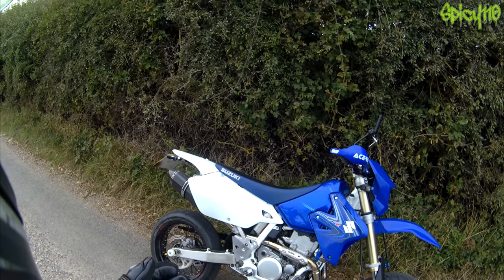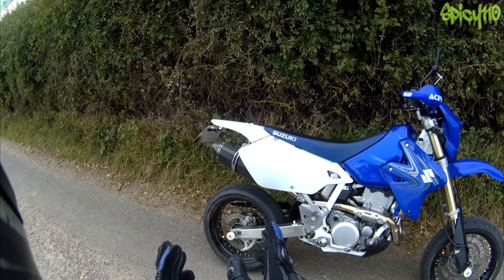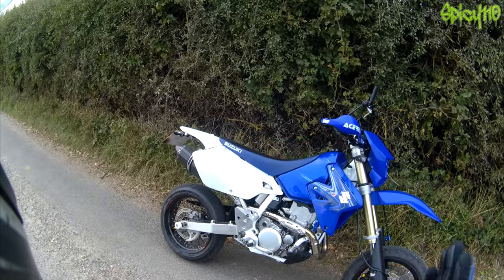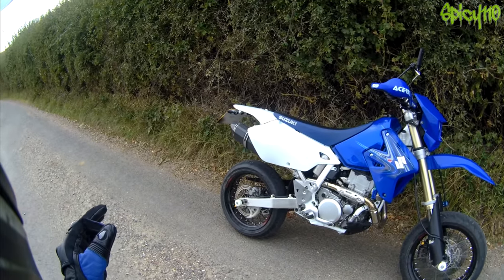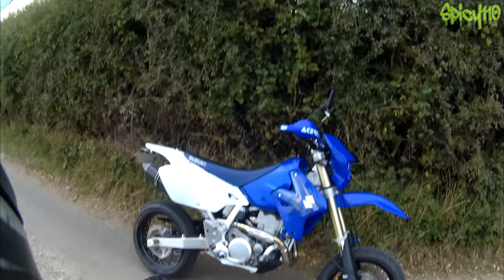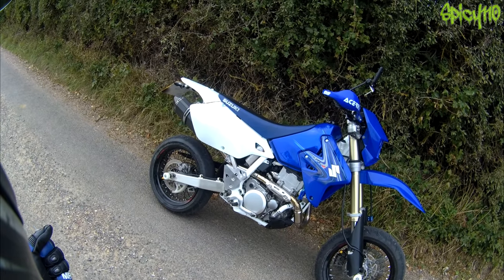What's going to be even more interesting is that I can now compare a 160, which was too big, to a 150, which is correct - because this has got a four-and-a-half inch rim. Before anyone says 'but if stock is 140 why go to a 150' - the profile is still correct, so it's not a problem. However, as I found that Zero to have such fantastic handling, it'll be interesting to see if this bike will be in any way similar to that. I have done about 100 miles on this so far and haven't really pushed it too far.